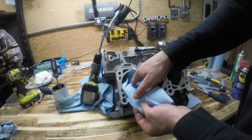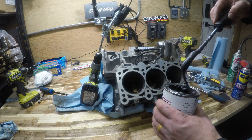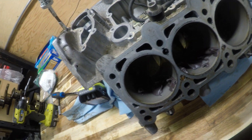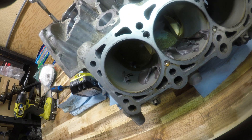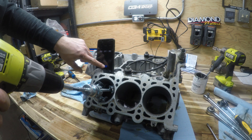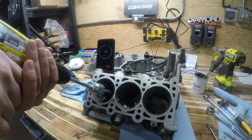Cleaning bank two here and making sure she's dry. What you should do instead of using a screwdriver like I did for applying the paste — get a foam paintbrush, something non-metal. That was poor planning on my behalf, so do better. I'm trying to get an idea of how much I'm putting in there.